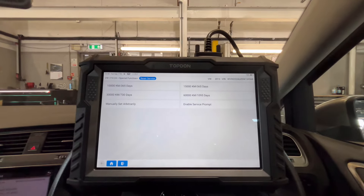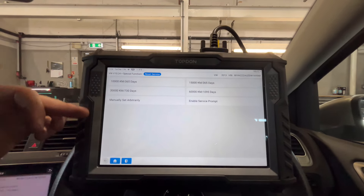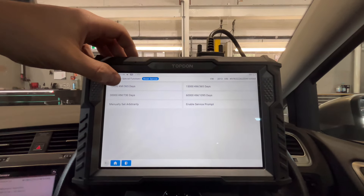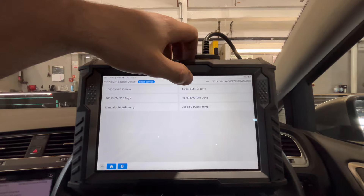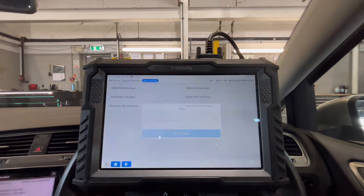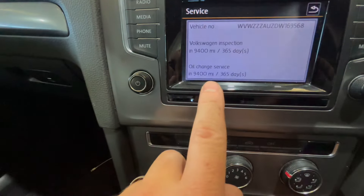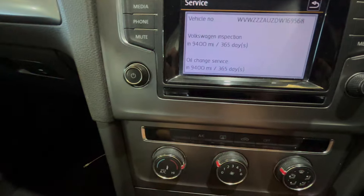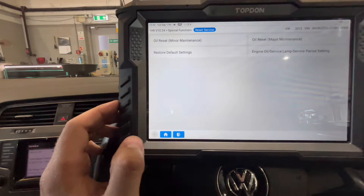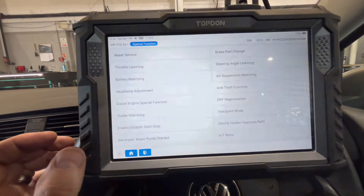We'll do major. You've got two variants: a year or 10,000 kilometres, which is 5,000 miles, or a year or 15,000 kilometres, which is 10,000 miles — so we go for 10,000 miles a year. If you look back at the beginning of the video, these were all wrong. Now both inspection and oil change are true on the same day because it's had a service and inspection here with me today. That's all done and it's had a high-speed scan as well. We've let the customer know, and now we've got a nice clear screen.